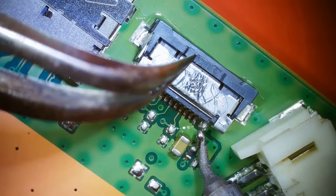We've got one loose solder joint right here and a torn pad on the board. I'm going to bend it so it sits about where it should, then use some conformal coating — it's liquid enough that I can put it here and it's going to flow underneath the port. I'll add some all along here, then set this aside and let it dry.